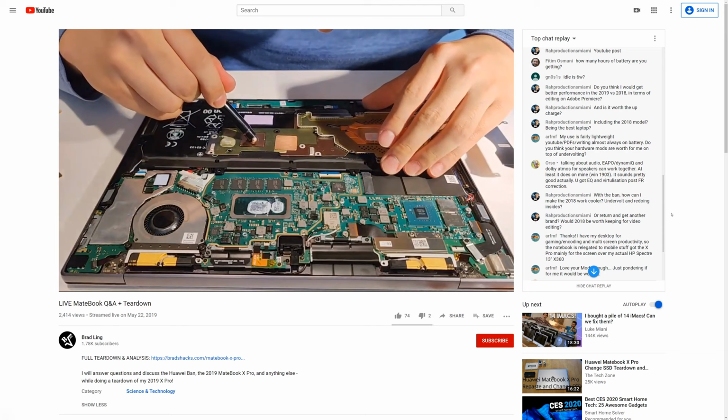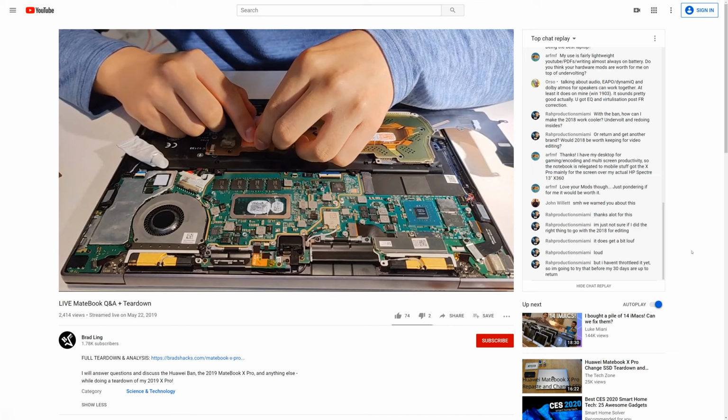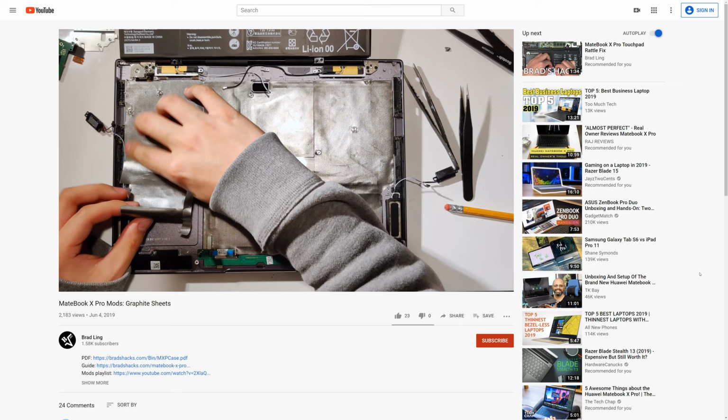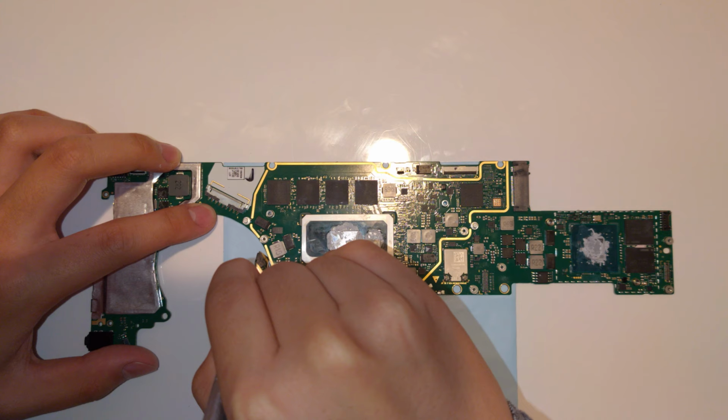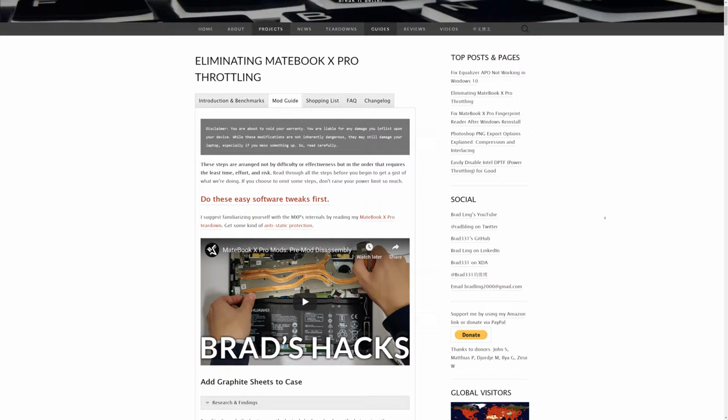Keep in mind that this is already a slightly modified MateBook X Pro to begin with, because I've upgraded the thermal paste and replaced the GPU thermal pad with a copper shim. I did those during a live stream on my channel, the second day I got this laptop. I've also added graphite sheets and thermal pads between the keyboard and motherboard to help spread the heat. Check out those videos, as well as a detailed written guide on my website, all linked down below.